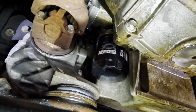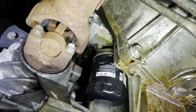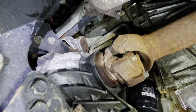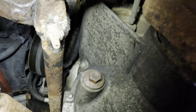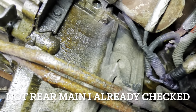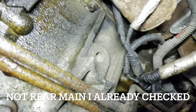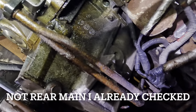Back down here below we can see the severity of said engine lubrication leak. Definitely looks like it's coming from the pan. I don't see much going on higher up. If we look over on the passenger side, we can see some heavy oil saturation around the backside of the pan and it follows forward. So we're going to go ahead and pull this pan down.